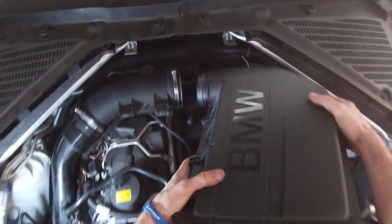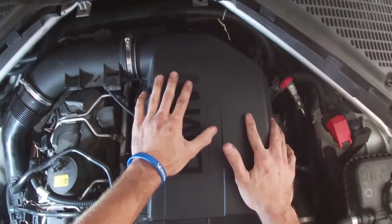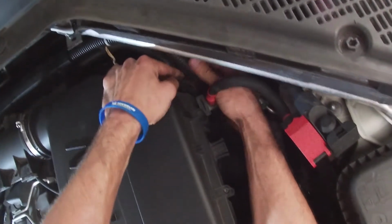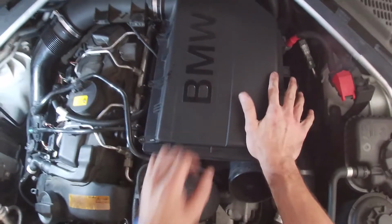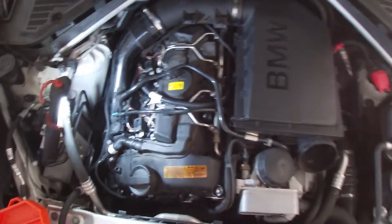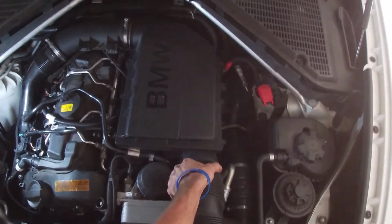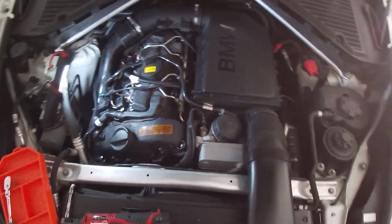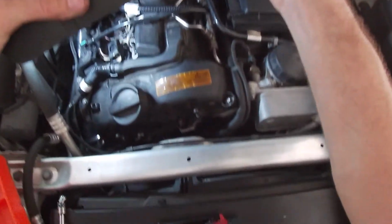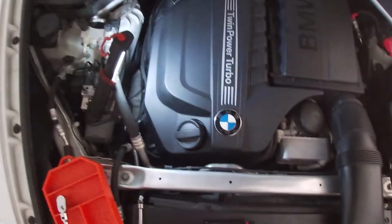Now that that's done, we can go ahead and reinstall the air filter box. Just gonna push it into the intake tube, align it with the holes in the bottom, and give it a good push down, and then reinstall the harnesses. And this one is broken. And then tighten the clamp. And then install the pre-air filter intake tube. And lastly, the engine cover kind of lines up with the intake tube and then seats onto the valve cover around the oil fill cap.